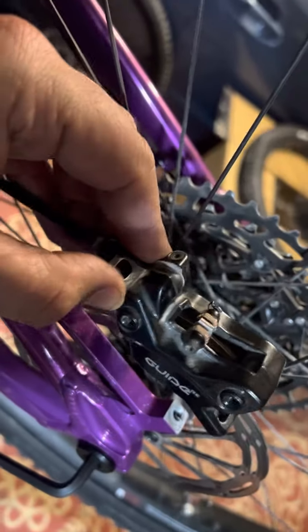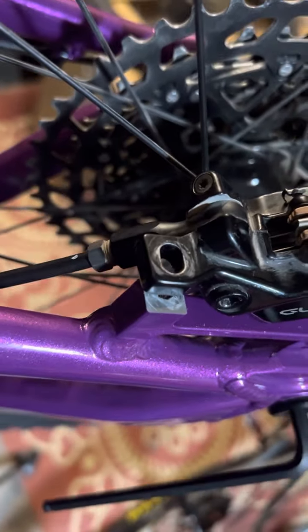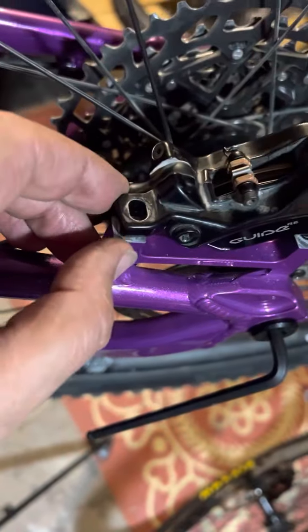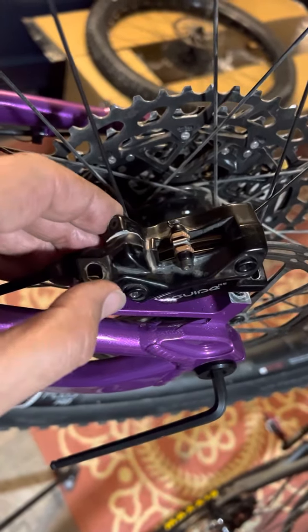You can see just how far off that is, how it doesn't line up. It's not as bad in the back, but literally the caliper mount splits the mounting holes right in half. Any way I try to mount this caliper on here, it's pulling it out and it's rubbing on the rotor.